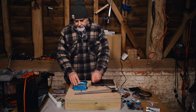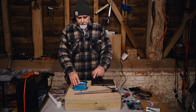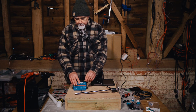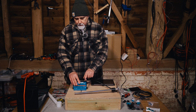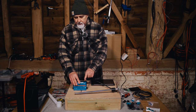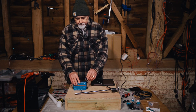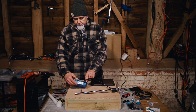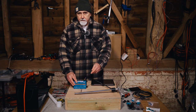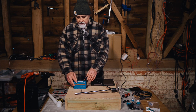The sending unit has two wires — a brown and a blue. That's all it needs, because it passes current through and measures the resistance. Based on the resistance measured, it will know how full the tank is. It doesn't matter which way these wires go, because the resistor works the same whether you swap the live and neutral around or not. These wires can be quite long — on an average RV, it's not a problem to run it along the full length. The amount of error you introduce is absolutely minute, as long as they're decent cables.